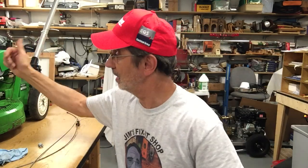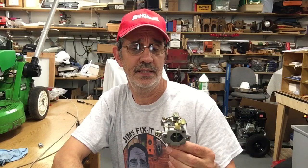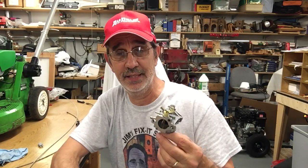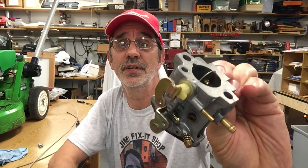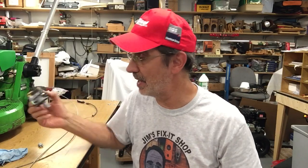The next video I'm going to upload separately — I need help, but this time it's not with the Lawn Boy. I did get it running by inducing gas through the carburetor into the engine because the needle valve was stuck. I threw the carburetor in my Harbor Freight ultrasonic cleaner — it took me longer to get it to start vibrating than it took to clean the carburetor — but the cleaner does an awesome job getting off all the grease, oil, and dirt inside. Today I'll be throwing it back on and seeing if I can get gas to flow — the little rubber-tipped needle valve was stuck and wouldn't let any gas in because the machine had sat for so many years.